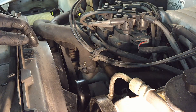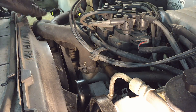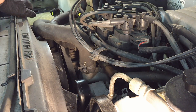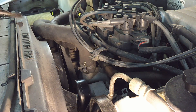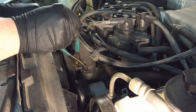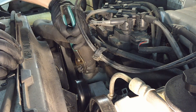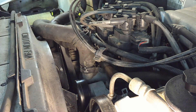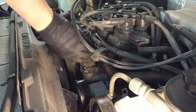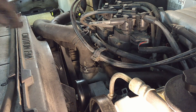Now the cooling has drained enough. We're going to start getting the upper radiator hose off. I leave it attached to the radiator itself and pull it off the thermostat neck right here. Loosen the clamp, pull it up a little bit, and then hopefully you can just twist it off.